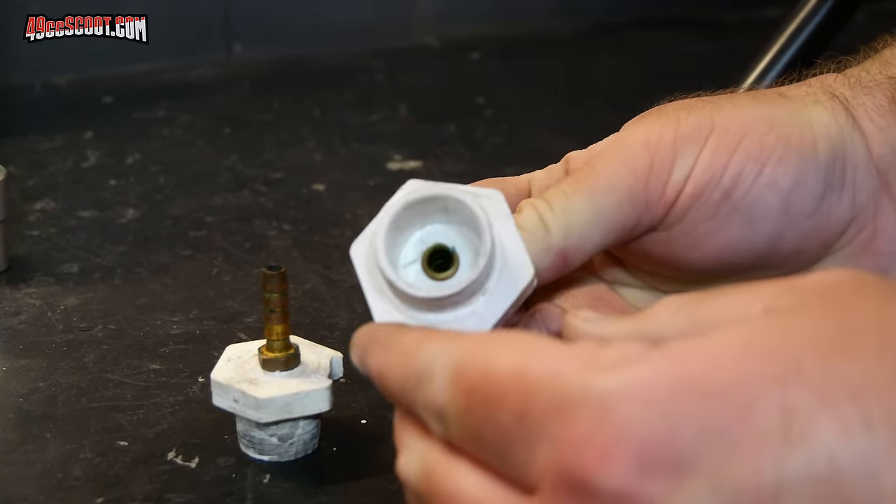This has been one of the hardest pressure tests I've ever done — with the cracked engine case, the leaking crank seal, and now a bad gauge. But please don't let that scare you off, because this is not how it typically goes. Most of the time you'll hook up your pressure tester, pump it up, maybe find a seal or a gasket leaking — usually something small — and sometimes you'll hook it up and find it's perfect right from the start. The other side of that is: even if it is like this, you'd rather know now before you're on the road breaking down, blowing up parts, burning holes in pistons. I hope you've enjoyed the video and maybe learned something. If you have, please like it, share it, and subscribe for more. Thank you for watching.